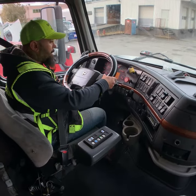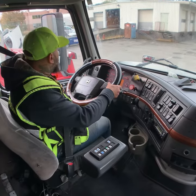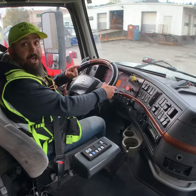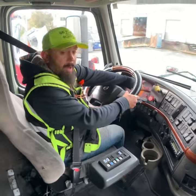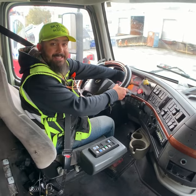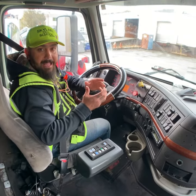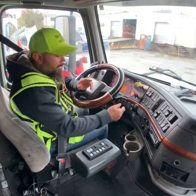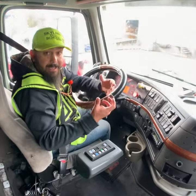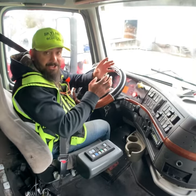Yes. Now we have to say the result. The air governor cut out at 130 psi, the truck passed the test. After that, you don't need to talk. It's so important. We have to be ready for the three important air checks.